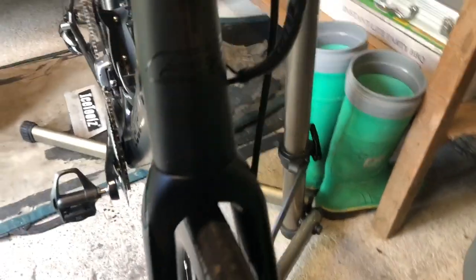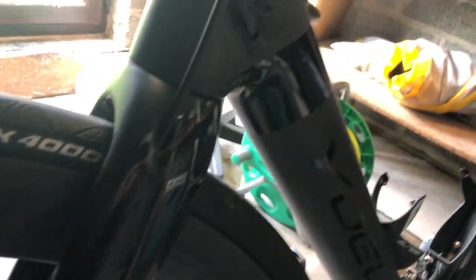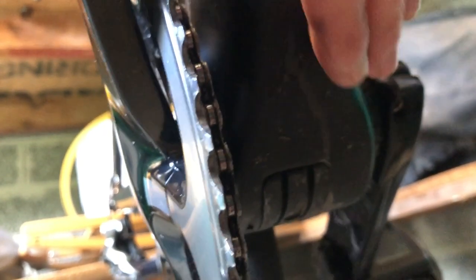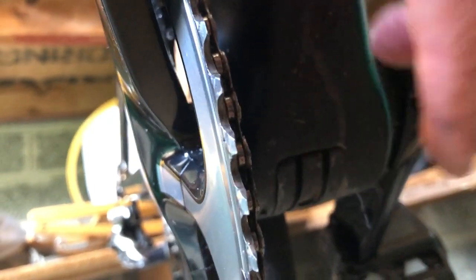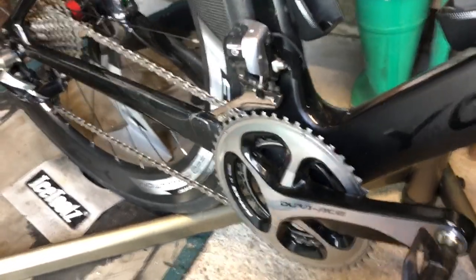I've put the front brake through the little clip. My rear brake and Di2 come out of the handlebar there — they're clipped together, bound together, and go inside the frame. I can't get them through the clip because there's not enough room. However, when I threaded the brake cable all the way down here inside, I actually put it around the shell, so it's sitting just underneath the cover. What I could do if I wanted more room is put it through where the crank spindle goes, through the bottom bracket itself rather than on the outside of the shell.